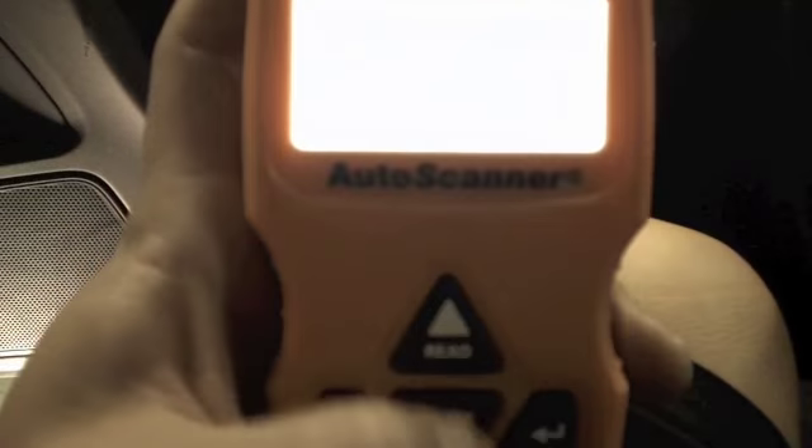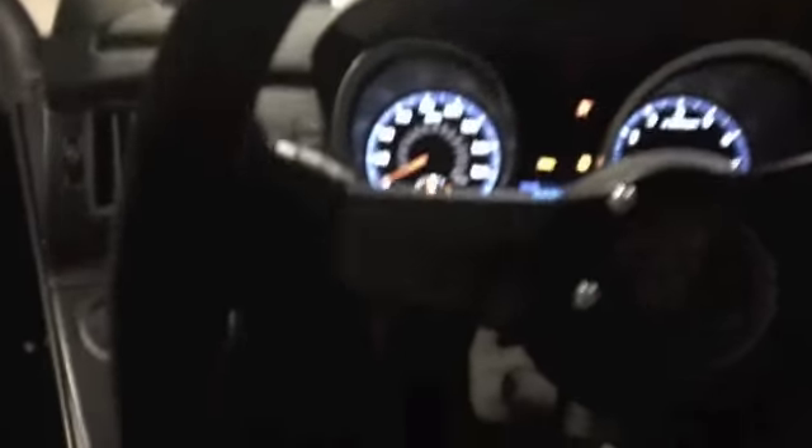No codes found — it was in the same situation. Same settings and everything, it says no codes found. I'm going to go back to vehicle information — VIN number, 6710. Remember this VIN number? No check engine light still. It's been running, and if there were DTC codes it should have thrown some already. The O2 sensor is not hooked up. What it says is no codes found. No secondary O2 sensors are hooked up, and same ECU right here — BTHR.